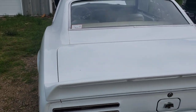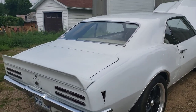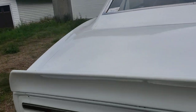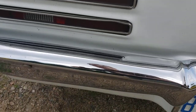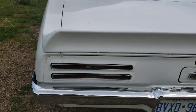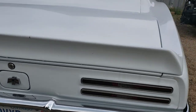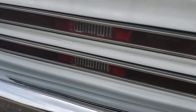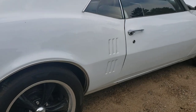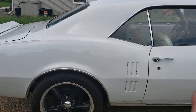This is a 25-year-old paint job and it's held up well. The car looks stunning — it's bright, it's very very shiny. Some things were overlooked when they did it the first time. You can see the chrome around that one light is kind of all messed up, so when we take the tail lights out I'll put that on the table, spend a bit of time, we'll straighten that out until it looks good. The paint's cracking between the two tail lights there, so we'll have to sand that out and fix whatever's going on. But basically we're going to go over the car and fix all the mistakes, make her smooth.